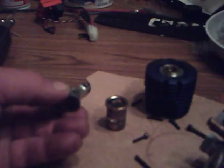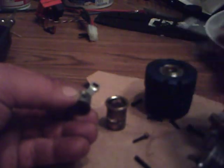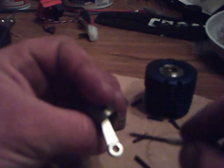There's a little tiny hole right there above where the crank pin goes — that's an oiling hole. That always faces towards the crankshaft, because that's where the air and fuel mixture with the oil comes into the engine. You want that hitting those oil holes so it pushes oil to the rod ends.